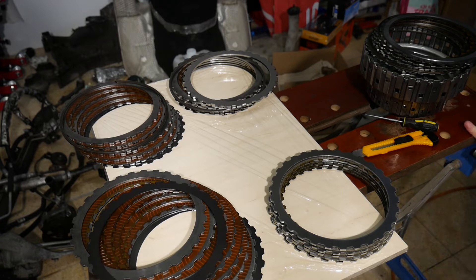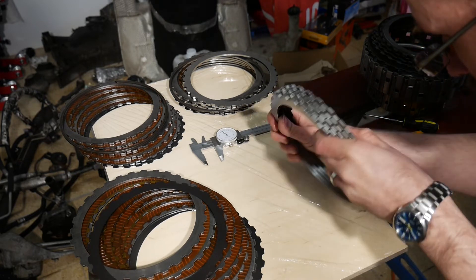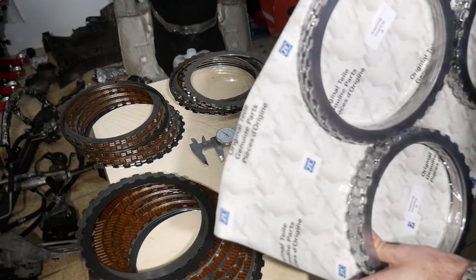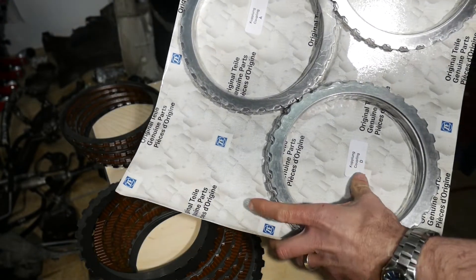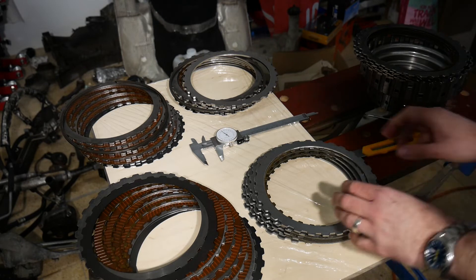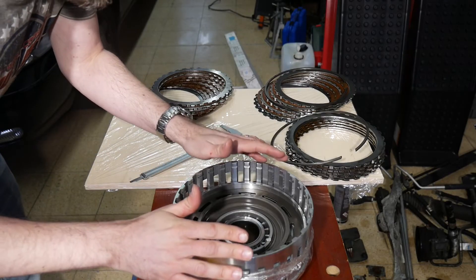But of course there's no clearance included in this. I'm quite sure I haven't ordered the wrong steels — those are universal for all 6HP26 — but obviously the old steels are far thinner than the new ones. I just figured out that this set comes with thinner steels also, but those are supposed to go into the decoupling. So I think it's best to shift this aside, finish the remaining clutches first, and see which steels can be used for the C clutch at the end.